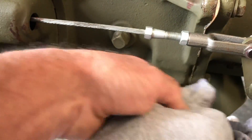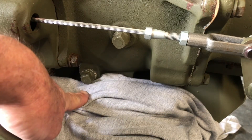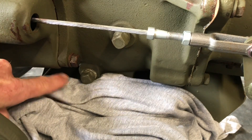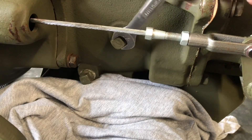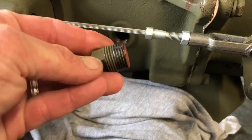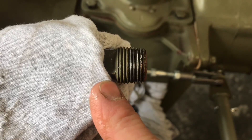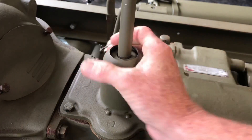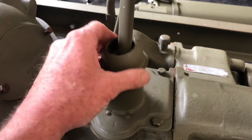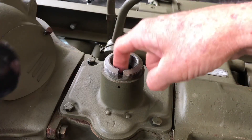Clean rags are a wonderful thing. I'm going to tuck an old t-shirt underneath the side of the T84 transmission right by the fill and drain plug. The transmission and transfer case are fresh rebuilds and I've already removed the drain plug and applied sealant to it — it was easy to get at with the tub removed. If the tub was present you could use a ratchet and extension with the special socket shown earlier. Remove the fill plug with a 9/16 inch wrench found in the center of the T84 transmission on the driver's side. If you look closely, the drain plug has a definite taper to it — this will be important when tightening the plug. On the top of the transmission, unscrew the cap that holds the shifting lever into place. Once the cap is unscrewed, remove the shifting lever and components — be careful not to drop any of them. Now you have a clean, clear opening to add your gear oil.